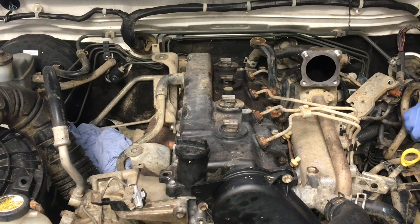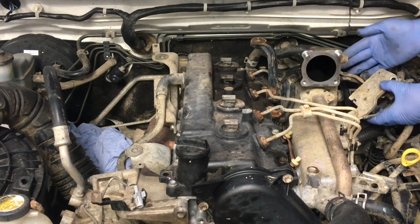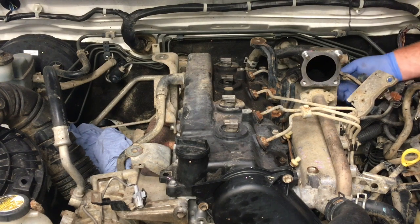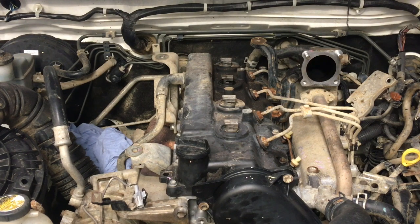It's obviously an earth or something, which I can't remember on this wiring loom where it is meant to belong. And that bolt from the stay, that will go up the top here. So the other two bolts from the bracket, they can all go up there together. They're basically the same. Now, as I said, you get this off, and then you can see the vacuum lines you've got to disconnect. What I'm going to suggest is, disconnect the two at the EGR valve and the one at this end.